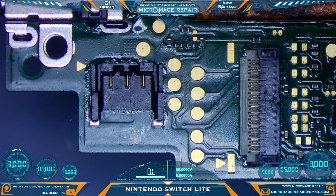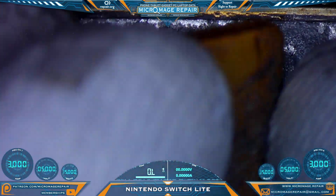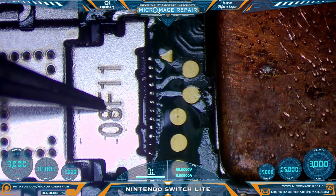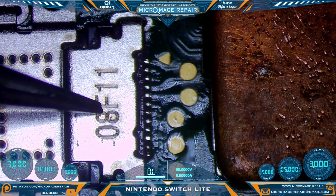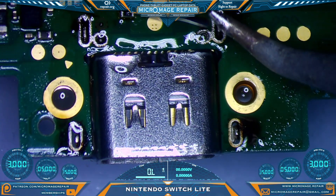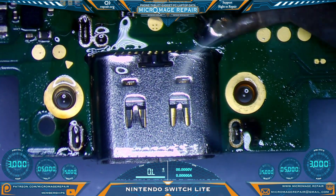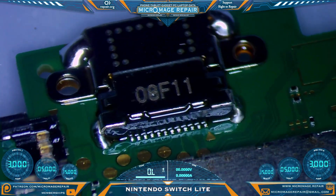Now because of how I heat the port from above, I need to protect these two connectors here. I'm going to use an old iPhone shield and a copper shim. I'm waiting for visual evidence that the outer pins have wetted — once I see that, which we are seeing now, I'm going to press down on the port, remove the heat, and wait for visual evidence of those pins to dry. Let's check our connectors — no damage done. We'll add a ball of solder to our tip and add a generous amount to the top two anchors. The bottom two do not take as much. That is excellent feed-through.